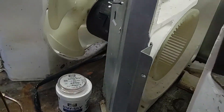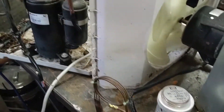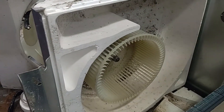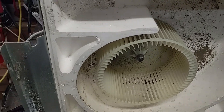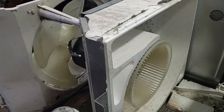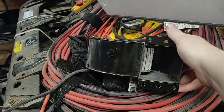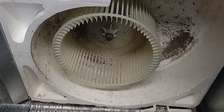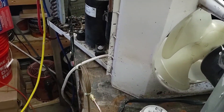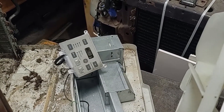Now that I have everything apart I just need to put it all back together again. I have the evaporator cut apart from the compressor now. Unfortunately the inside fan as well as the outside fan use the same motor, so I'm going to have to disassemble this and replace the indoor one with a new blower motor. Then I just need to build a new replacement for the styrofoam enclosure, solder all the lines back together, and then wire everything back up to the controller panel. And it should be good to go.